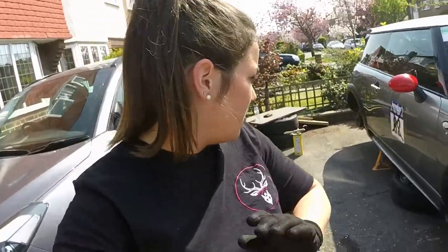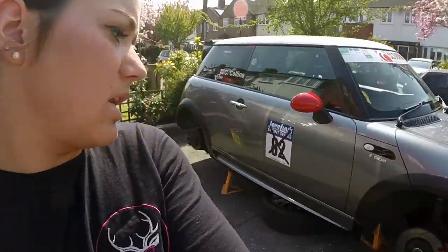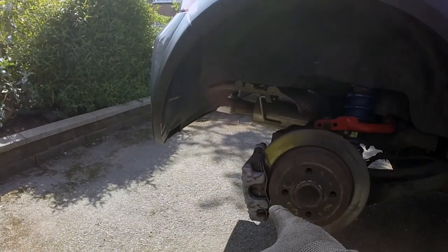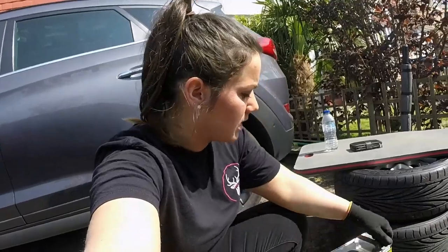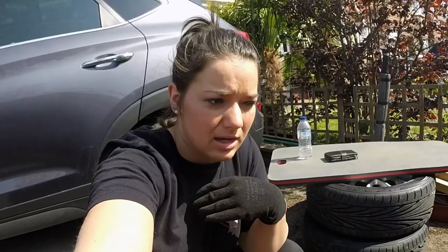So today my job - I've got it up on axle stands, I've taken all the wheels off - I'm going to wire brush the whole underside of the car, clear out all the arches, refit some new brake lines, and repaint all the calipers. The rear calipers haven't been painted - they were replaced probably a year ago. I've also got some clear wax oil to put underneath to seal the car, something I've been meaning to do for ages but haven't had the weather. Now I've got a couple of days to get everything done under the car and then go back to more mechanical stuff on the front end.